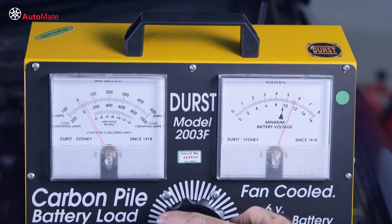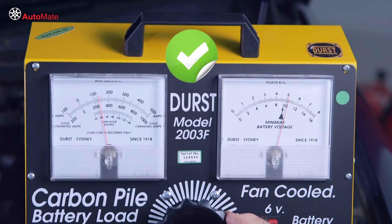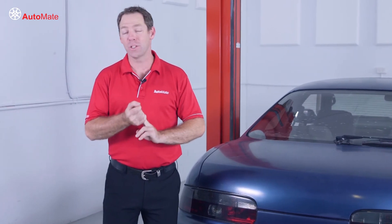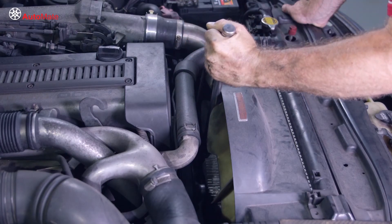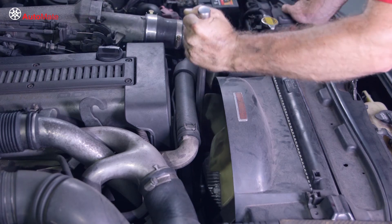With the growing number of electrical systems on today's vehicles, the battery is always the first component you should verify as working as designed. Second, we need to verify that the concern is not caused by an engine mechanical issue. Disable the vehicle's ignition system and attempt to turn the engine over by hand using appropriate tooling. If the engine rotates as designed, then we can move on.